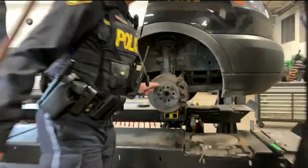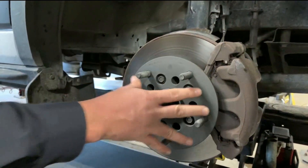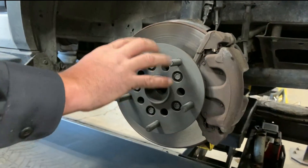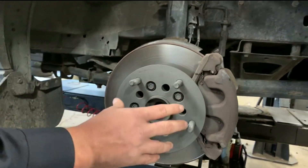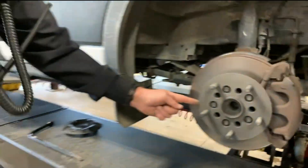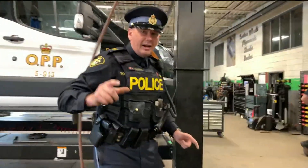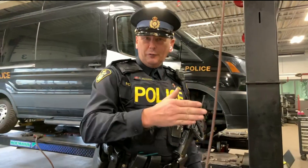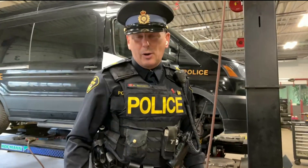When these tires come off, one thing you really want to make sure is when you pull that wheel off, you look at the surface — the hub that's touching the wheel itself. Take a wire brush and make sure that's all cleaned up. This is actually a good time to check your brakes as well. If you're doing this on the driveway, make sure everything is mounted properly and that there's no rust or debris, because if there is debris between the surfaces, once you start driving, that rust and debris falls out, comes loose, and now you lose the clamping pressure.